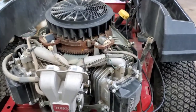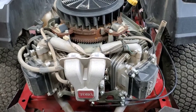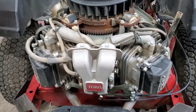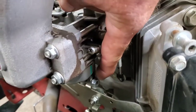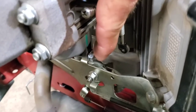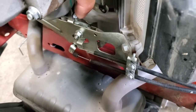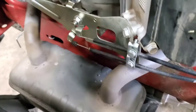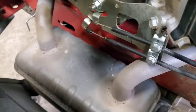It just lifts off. First thing I wanted to do — runs only on choke tells me we've got good fire, we've obviously got good compression. First thing I wanted to address is a fuel issue, because if you pull it on choke you're sucking more fuel in. So the first thing I did was look down at the bottom of the carburetor. There is a bolt right there on the bottom of that bowl. All you have to do is loosen that bolt up, pull it out, and the fuel will run out. Make sure your muffler is not hot because it's going to drain directly on it. And what you want to watch for when it drains — I've already done this and there's no fuel left — you're looking for water droplets, and it'll be easy to see. And that's what we found in this case.